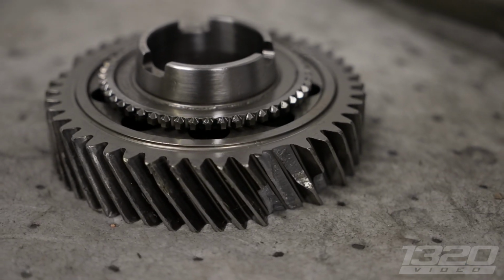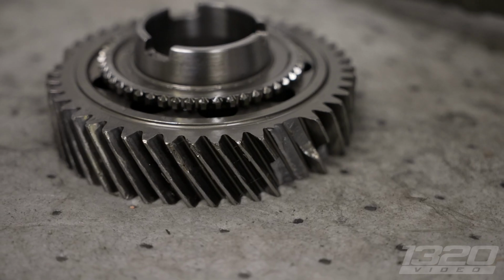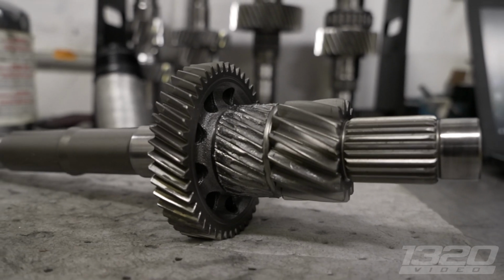All right, so now we know the input shaft sheared off and third gear. And I assumed it was third gear because the issue happened when it shifted from second to third, and second gear is already upgraded. And when Martin was looking at the Motec logs when I was there a while back, he did say that the input shaft speed sensor showed whatever RPM, and then it went to 0, and then it came back. So I was suspecting that was an issue as well.